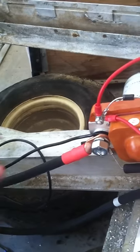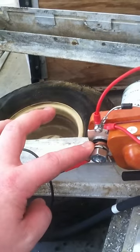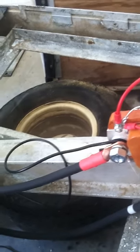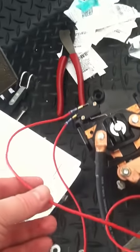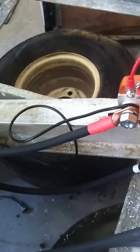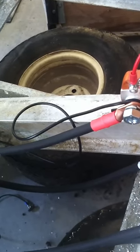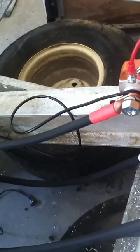Coming off the one that goes to the back — the battery positive — I have the resistor here and also this black wire, which I need a different connector for. This is also going to the key. I'm assuming the forward/reverse micro switch wire and this black wire going to the key — it doesn't really matter which part of the key they connect to, since that just makes the final connection.